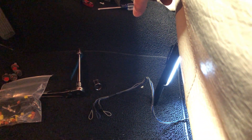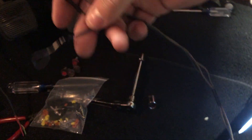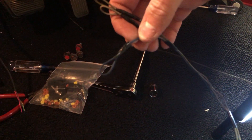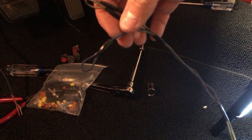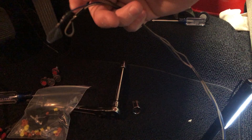It's a nice little tidbit — if you have some extra ECU wires and you're de-pinning your harness and don't have these three wires, you can use wires de-pinned from the ECM. The three wires are: set/coast, resume/accel, and a power wire. It tells the computer you want cruise control, so when you flip the switch to on it sends 12 volts to the tach module and engages the system.